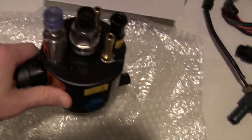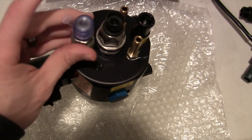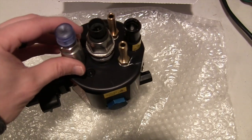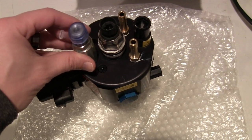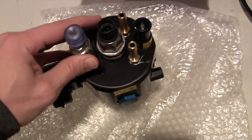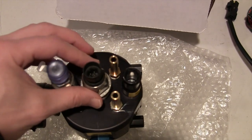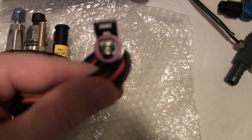Here's the solenoid, and here's the high pressure inlet — I'm doing this with one hand so I apologize. The high pressure inlet has a good swage fitting on the inside; this is a six millimeter quarter inch, which is most common. We do have others available, but this six millimeter quarter inch high pressure tubing is more than adequate for anything up to a seven or eight liter engine. This is the pressure sensor, and it comes with a three-prong cable that connects and plugs into your ECU.